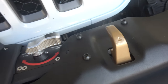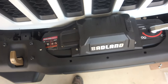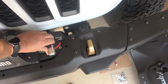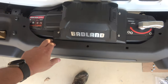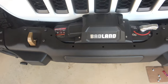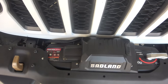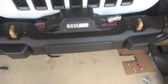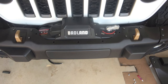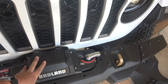So that means I'm going to have to take the bumper off, undo the winch, slide it back to the next two holes, and then put the bumper back on. On the good side, at least right now, the lever clears — it's got plenty of room. So I tightened up four of the eight nuts on the bumper bolts. We're clear here, but we are touching here, so it's going to be tight. I might have to look at moving the control box. It definitely has to go on the back four holes. Bumper off — use the back four holes.